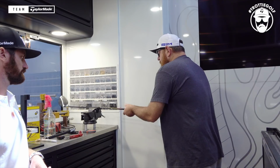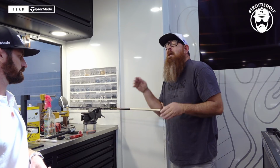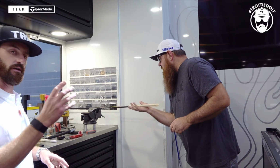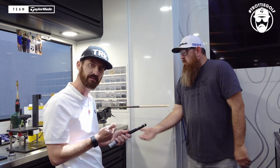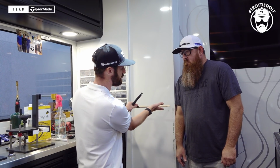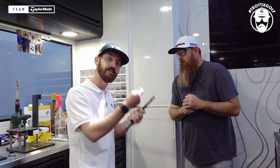All I'm going to do is put that on there, and then I'm going to use the palm of my hand to roll it so we don't have any type of creases in the tape, which you're going to be able to feel. Now when it comes to 3M tapes, there's a seam that's gone underneath. Wade's just put his finger down the backside of the seam there. If you're putting a second piece of tape on, it's important you get the flat piece, the start section, underneath the seam, because you don't want to build up the ridge in the tape.